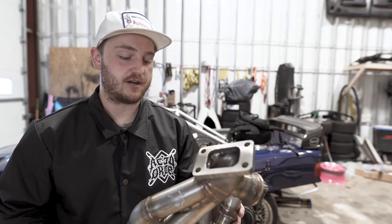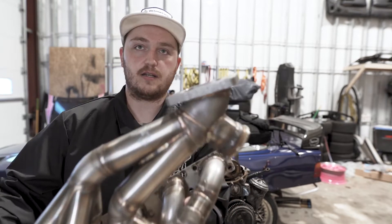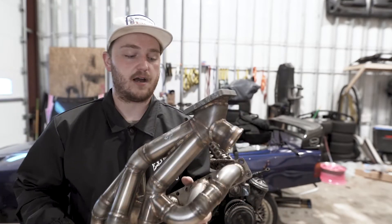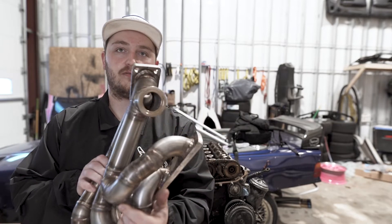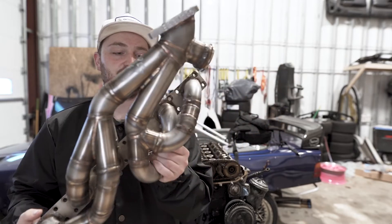The first part I want to talk about is probably the one I'm most excited about out of the entire bunch. It's an exhaust manifold, and I'm stoked on it because it's weird, different, cool. It's from across the Atlantic Ocean — from Poland — made by K64. I'm in a couple of Facebook groups for boosting E36s and did a pretty good amount of research. It's set up for a GT35-style turbo and has a 44 millimeter spot for the wastegate. This thing is just freaking sweet.